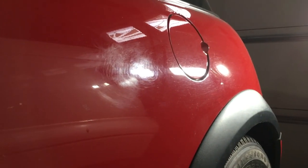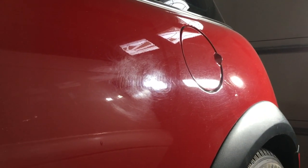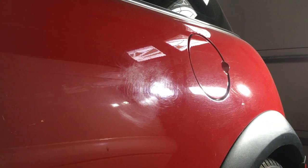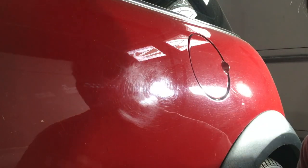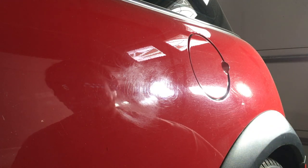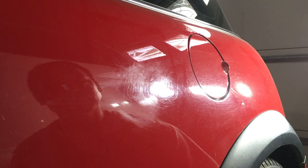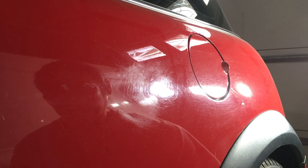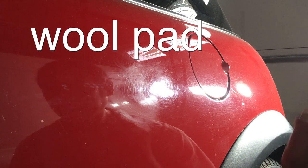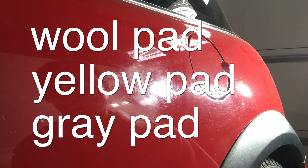So let's just get going on it because this is going to be a quick, short video. This is not a full how-to. It's just going to give you the steps that I'm going to take today. These are your normal steps, but I'm going to work it real quick. It's not a show car. The procedure is 1500, 3000, 5000, followed by wool pad, yellow pad, and gray pad. That's all there is to it.